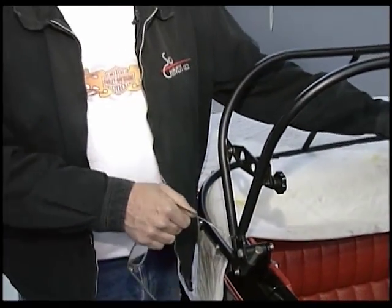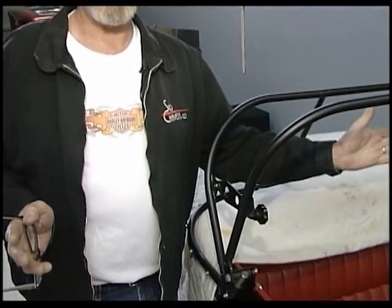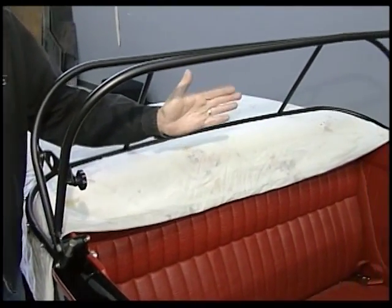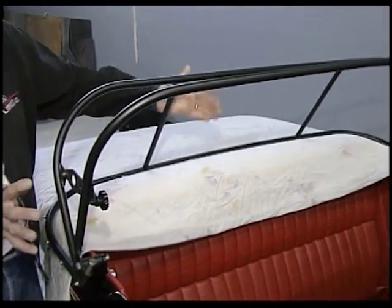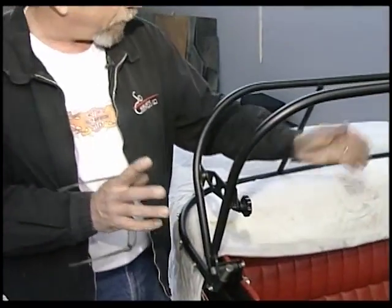The original tabs on a Ford measure approximately 50 inches apart — they can be 51 or as small as 49. If you were to measure this top sitting on the bench, the mount points are probably about 52 or 53 inches wide. Don't let that bother you. This top is engineered to have a little spring in it so you pull it in a little bit. Don't be surprised if you mount one side and have to push the other side in a little — that's normal, that's the way it should be. About 50 inches apart; as long as you've got a little push in, it's all set.